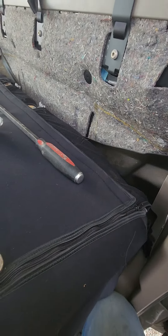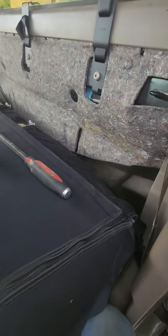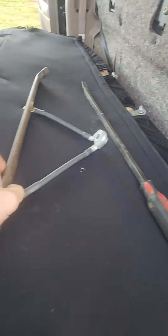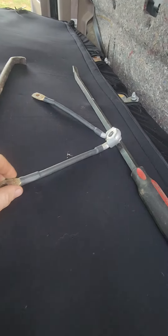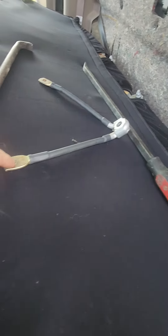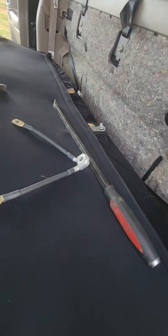To get it down, then after you get it down, you break this loose. You're also gonna have to go in behind here and remove this little cable to get it to where we are now. I think it was an 18mm that we used to loosen that, and a 15mm on those right there, to be able to get it to lay down this far.